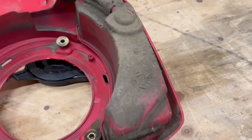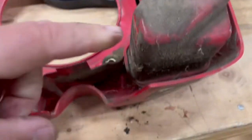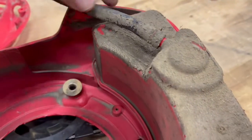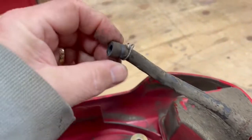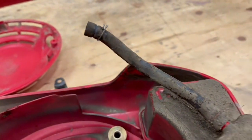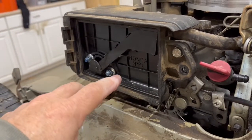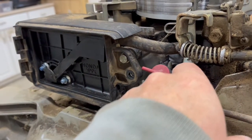This is what it looks like underneath. This hose line could certainly be cracked somewhere. I'll have to try and get it off, clean it up a little bit, and take a closer look. If I have some replacement hose line I'll probably just replace it to be sure. Next I'm going to remove these two nuts and pull this bolt off, and then I think this air cleaner cover will come off so I can pull the carburetor — maybe that'll give me better visibility into what's going on back here.